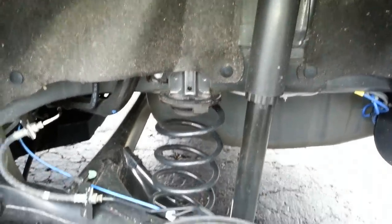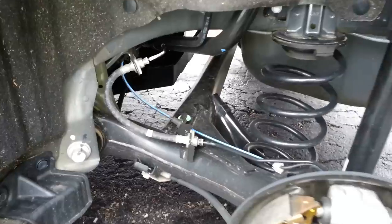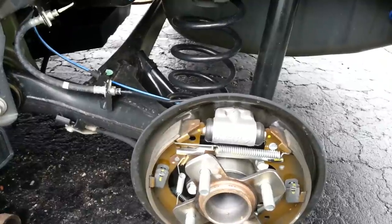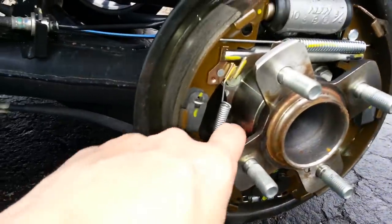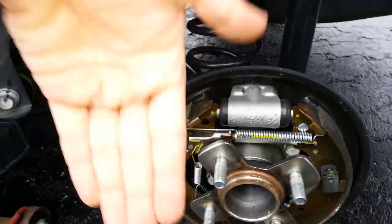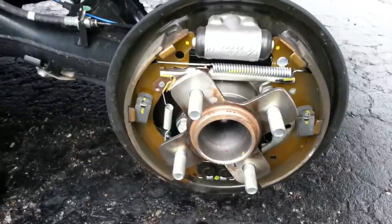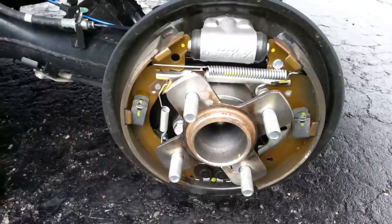For those that are interested, sometimes it becomes necessary to adjust the rear toe and the rear camber of the rear axle. This is a solid beam and the hubs are mounted on it — I thought they were welded and I apologize for my previous post saying that they weren't. It turns out the rear hubs are bolted on — one, two, three, and four — so you can actually take this hub completely off and put a shim on the back to adjust for rear toe and rear camber. So thankfully that can be done if you have rear alignment issues, just the same as with the GE and GD style bodies of the previous generations.